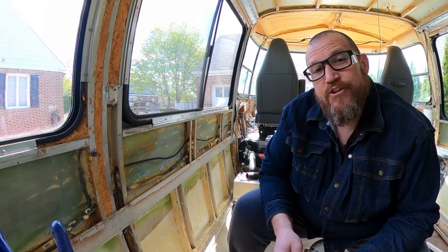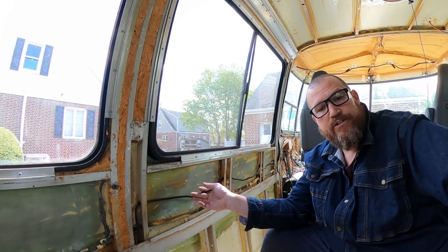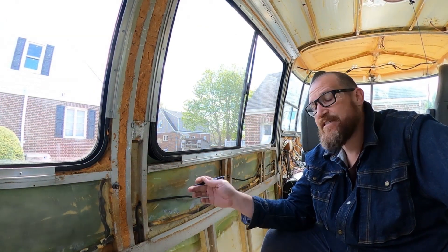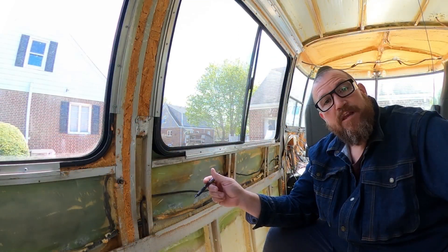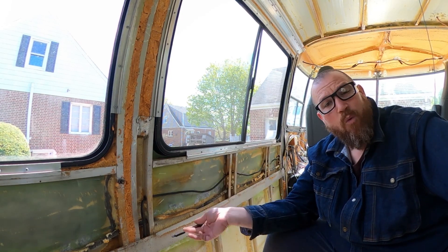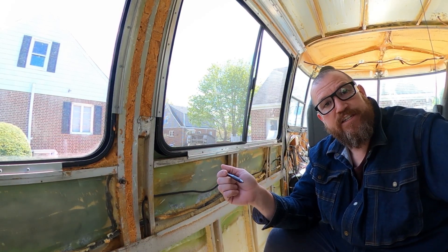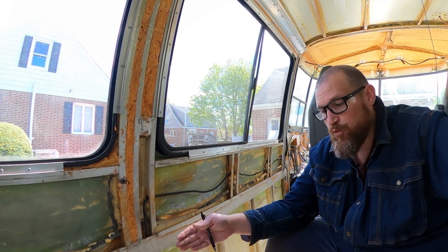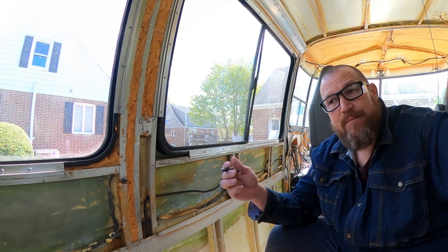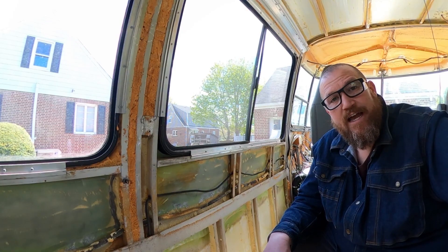To start off, I've decided to change the way I'm going to be doing my panel installation in the coach. I'm going to be making the panels right in place instead of making an external wooden buck. The reason I'm doing this is because all the walls aren't quite the same shape — some of the panels have little deviations and deflections in them. By making them in place, they will fit the actual area much better than if I had made a generic buck outside and then brought the panels in cutting them to size.